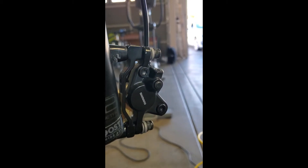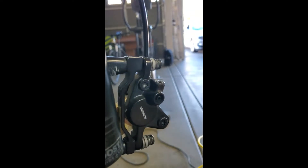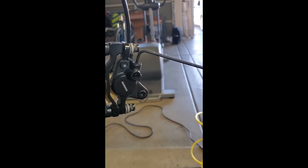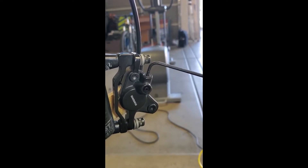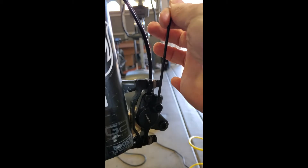Come down to your brake caliper and you'll see a little rubber grommet and a little hex plug right there — that's where your 3mm hex is gonna go. Take the grommet off — pretty easy, don't lose it, not the end of the world if you do. Get your 3mm hex, put it right in there, and crack it about a half turn — maybe three quarters of a turn — and that's it. Do not remove it, just leave it. That plug is basically an internal stopper to prevent flow out of that hole, so just break it loose like that.